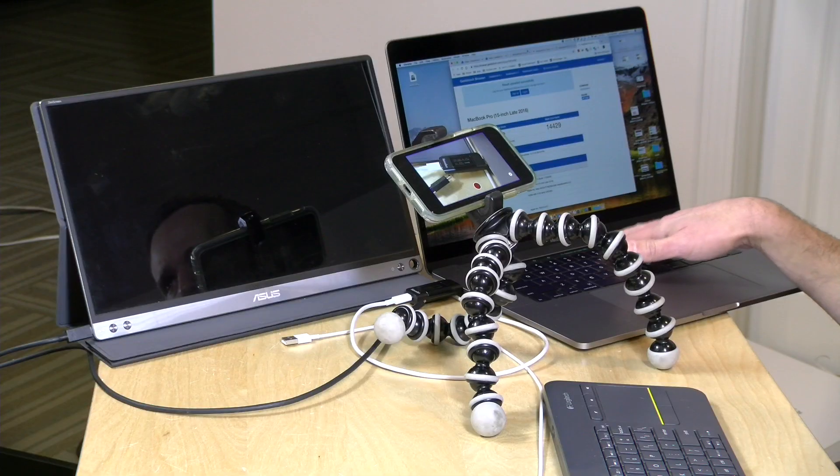Let me know if I missed anything in this test, but I think at least with the Mac it looks like it will get enough power to be at full performance even with a 60 watt dock — your battery may not charge, or may charge slower than with a more powerful adapter. For MacBook Pro 15s and real power users, I do suggest getting a Thunderbolt dock. Most Thunderbolt docks I've tested from Kensington and other manufacturers start around 85 watts of power delivery, with some going up to 100 watts for high-powered Windows devices. Let me know what you thought down in the comments.